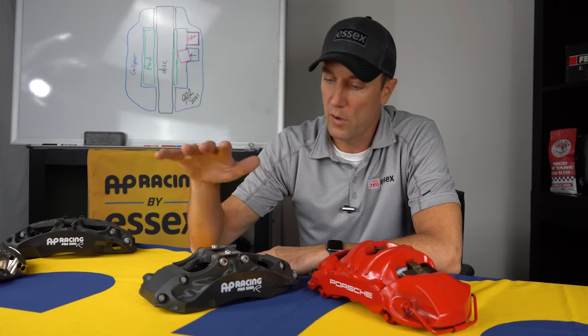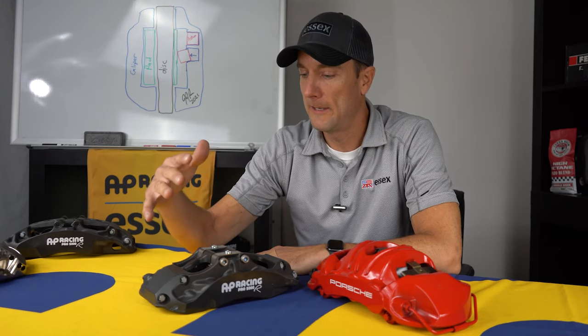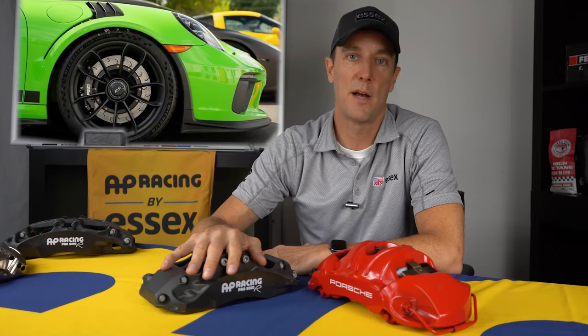So overall, this finish is designed to go to the track to pound on it. It also looks cool. It matches with the wide range of colors available on the GT3, whether it's something that's even paint to sample. This gives you a nice race look, and it also holds up a lot better. So a lot of advantages for the anodized finish versus a paint.